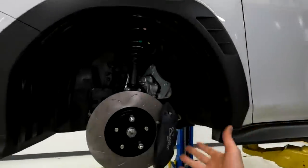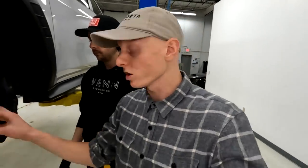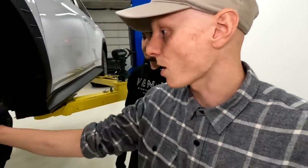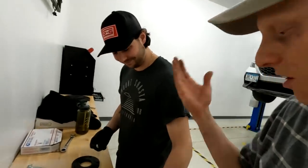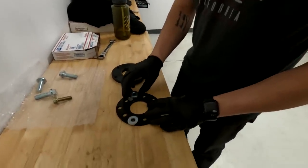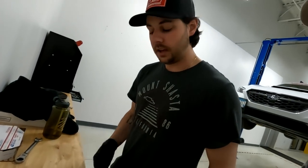So yes, you can get a big caliper to work on a 2022 WRX with a little bit of spacing. The next step is to make some sort of custom spacer to go on the inside of the rotor. We're clearly going to have to use the extended studs as well, since the OEM ones won't be long enough to hold a wheel properly after spacers. I'd say it's 90% good news, 10% moderate success — trial and error.